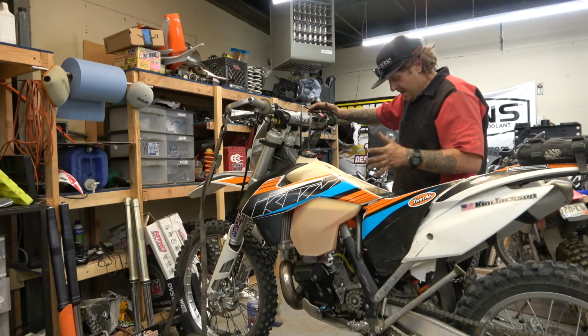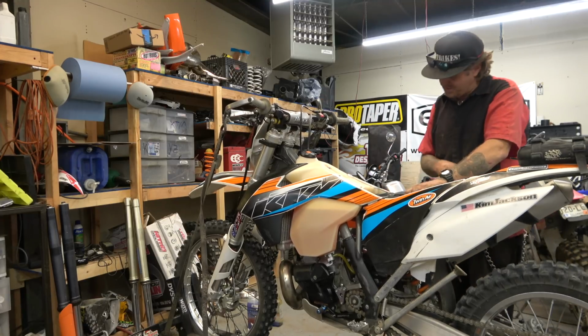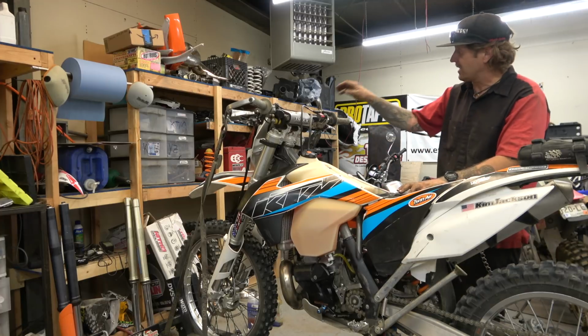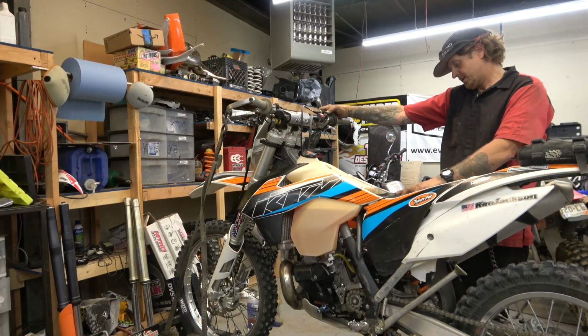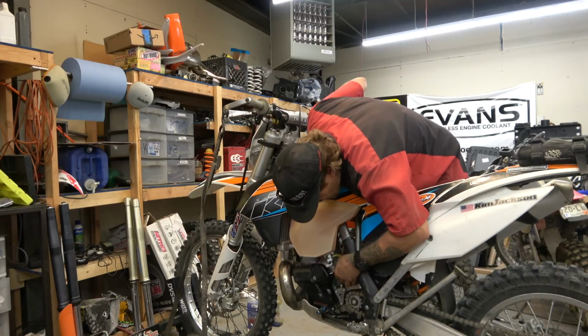So I think we got everything done. We got the new spark plug, oil's in the bottom end, everything's good to go. Oil and gas, I say we hit the button and see what happens. Oh, there we go. Turn the choke on because I didn't do that.